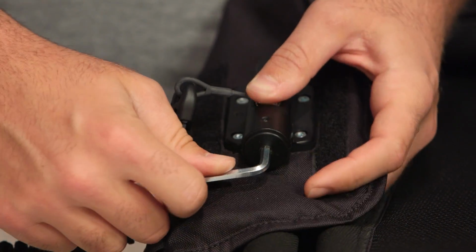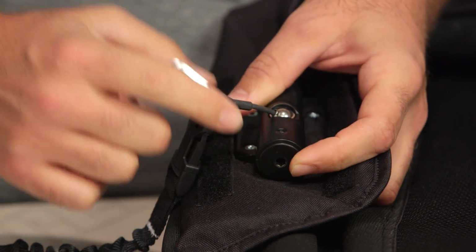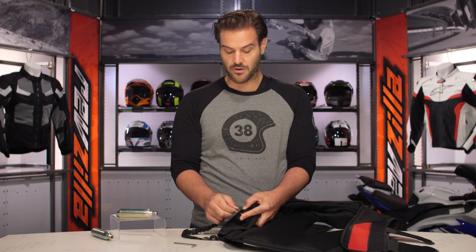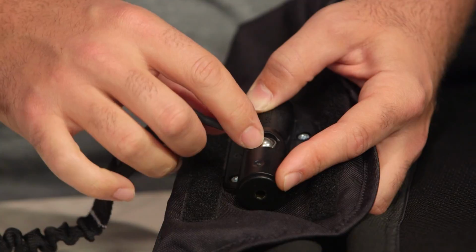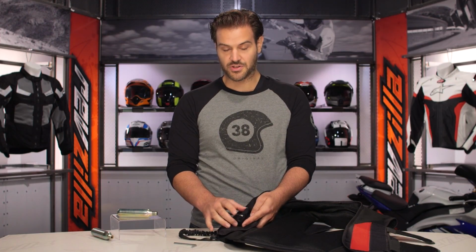And once you feel this go snug, you'll notice that that bottom piece is going to be flush against the actual housing itself. Now, before you go ahead and put that new canister in, just make sure that tether is securely into place. You should notice the outer ring is secure and flush, and then that ball is moving freely. Now that's pretty much steps 1 through 5.